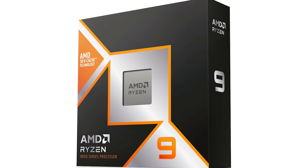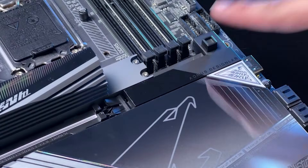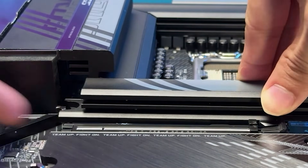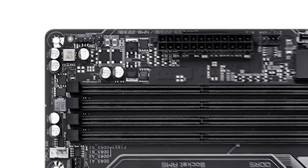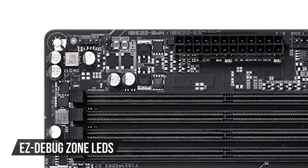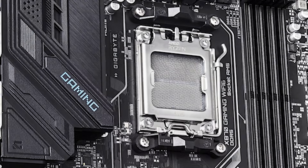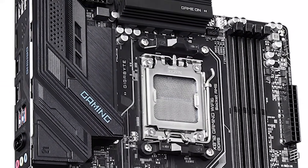This is especially important for higher-end CPUs like the 9950X3D. Following in the footsteps of most mid-range motherboards, this one also has a quick-release mechanism for the M.2 and PCIe slots, meaning you don't need to fiddle around with screws or difficult locking mechanisms during installation. For troubleshooting, you get simple debug zone LEDs that correspond to errors relating to different components. In terms of power delivery, you get hybrid 8+2+2 phases, totaling a 12-phase design.